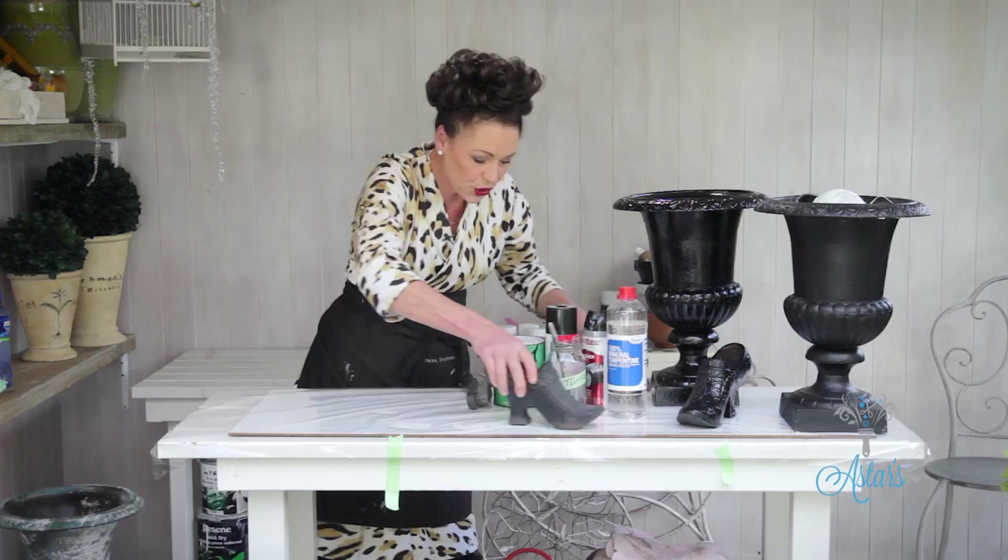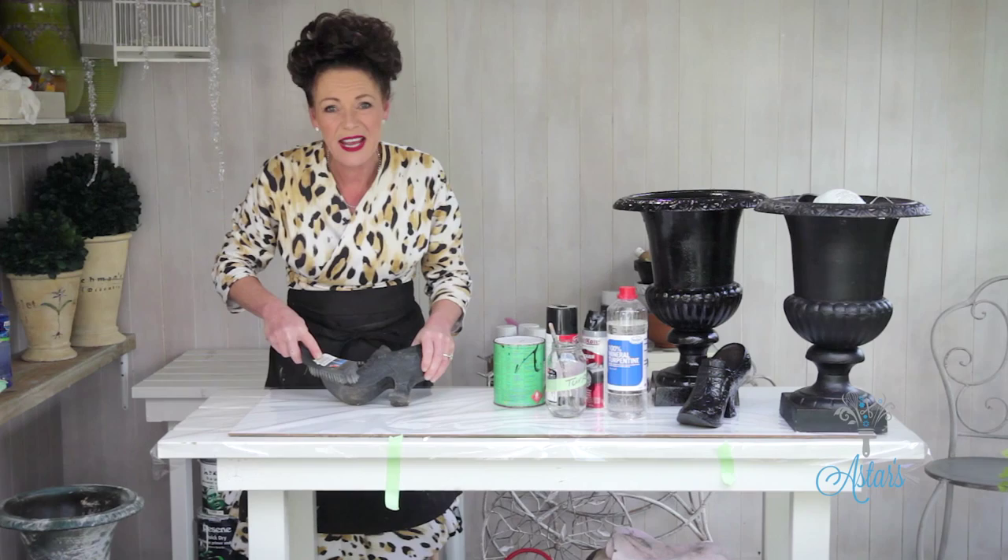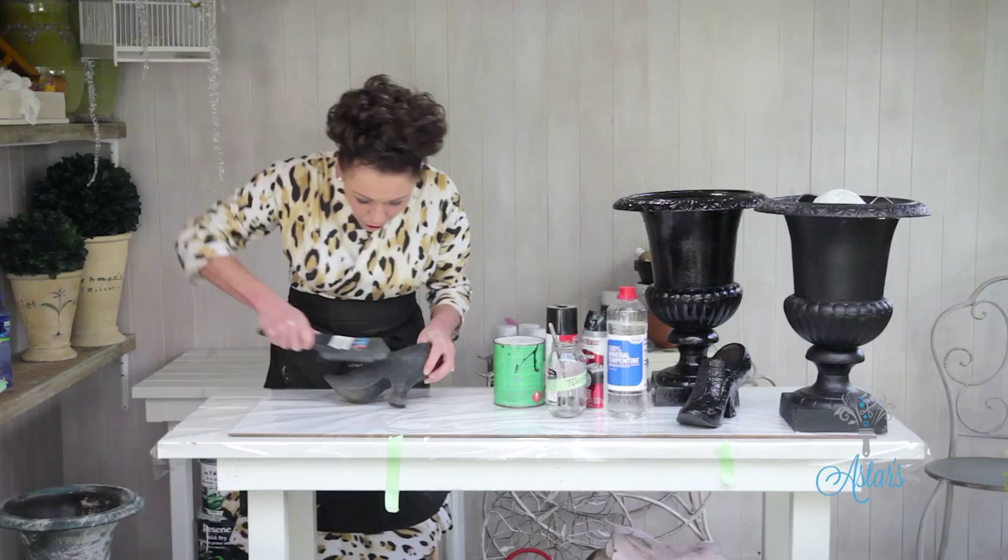The shoe needs to be completely sanded down with a wire brush to get rid of any rust. Rust is like cancer — if you don't get it all, it's just going to come back. So it's most important that you do your prep right.